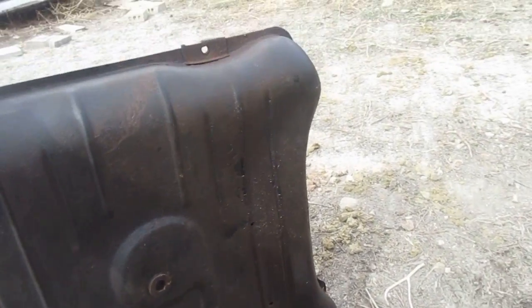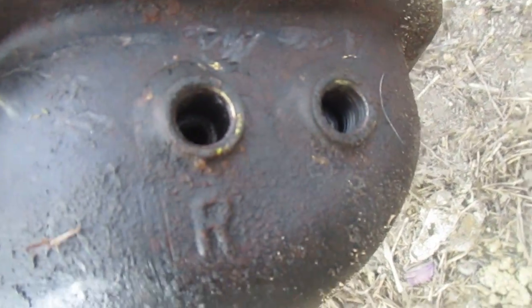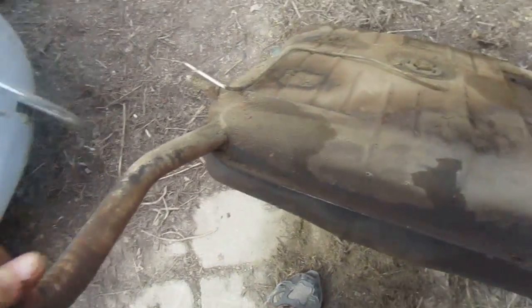You can see there — one and two nice holes. Always a nice little surprise. If you're gonna work on these old cars, you've got to take the gas tanks out anyway and clean the interior — get the varnish, rust, and debris out, because otherwise it's just gonna go into your engine and destroy it. There's the gas tank, secured with three bolts — 14 millimeter wrench pulls those off. Sometimes you can find them on eBay or a wrecking yard.